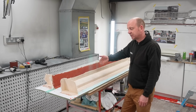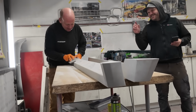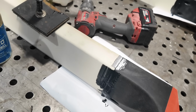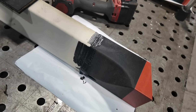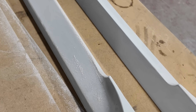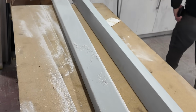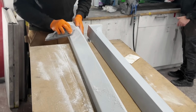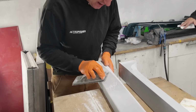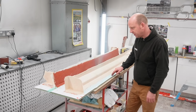So yeah, these are made, obviously there's quite a sequence of events here. We make the pattern. The central part was in polyurethane tooling board. The ends were 3D printed in carbon fibre reinforced PETG, I believe. Then the ends were glued on. The whole lot was smoothed, given a fine covering of sprayed polyester, sanded to 320 grit paper all over, then that was primed, spot primed and waxed, so that the whole lot was very shiny, and then it was glued down to this vinyl wrap topped piece of moisture resistant MDF as a flat board.